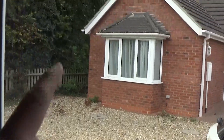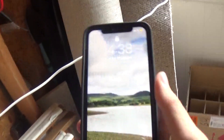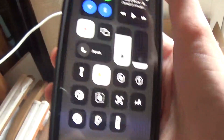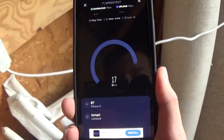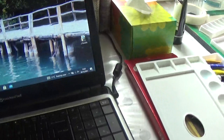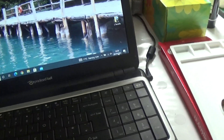I'm in the garage now — sorry about the noise, my grandpa's outside with the leaf blower. The BT Hub 5 is in the house. We're going to plug the extender in here. While we're waiting for it to sort itself, let me show you what speeds we're getting in here right now. On 2.4 GHz we're getting around 15 Mbps — 5 GHz won't reach in here at all. This is the actual room, and on the laptop it's showing literally just one bar of signal, and it's the same with my phone — only one dot.